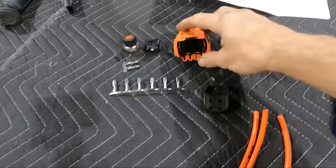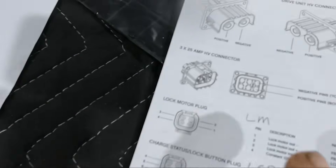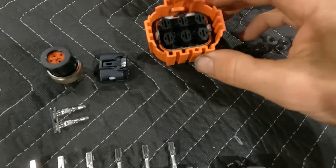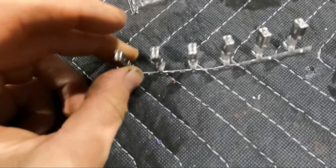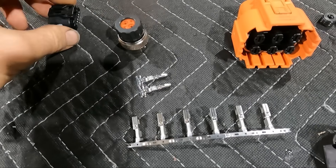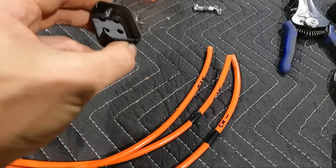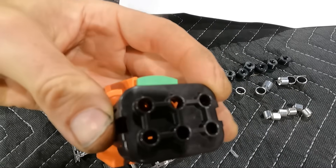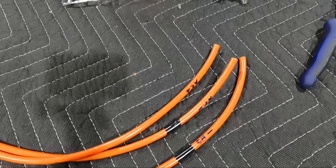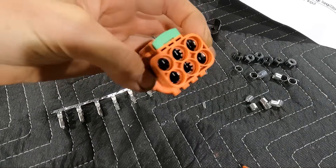Since the charger and the AC both come to the same connector, I'm going to make my cabling at the same time. I'll label them charger and air conditioning, and put negative here just in case it gets smudged so I know which are negatives and which are positives. According to the diagram, negative top, positive bottom — so two negatives go up here, two positives go down, with the associated pins. This connector has a cutout so it only goes in one way, so I've got to make sure negatives go next to the cutout at the top and all the positives at the bottom. Then we'll start cutting back, putting our sleeves on, crimping our fittings, sliding them into the slots, and we're ready to go.